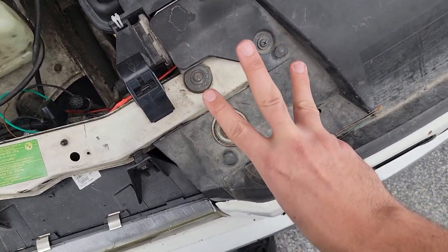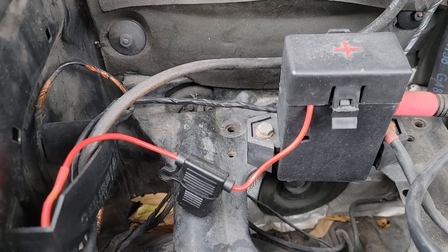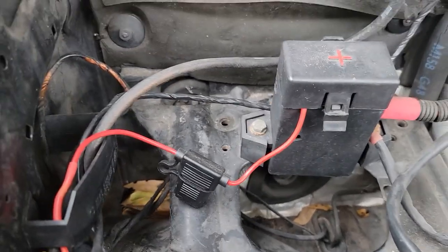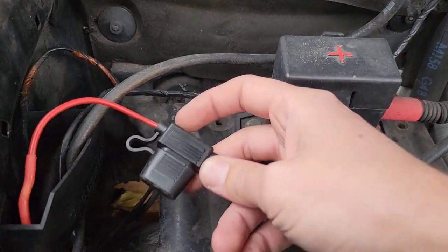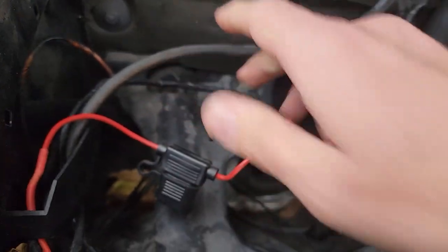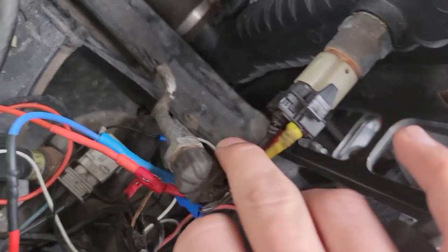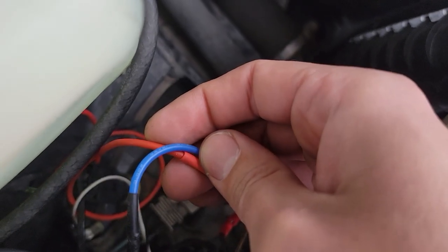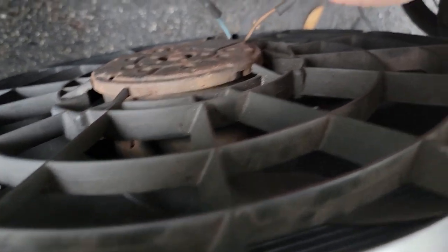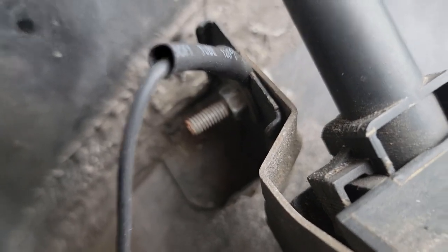What we want to do is bypass the medium speed. With the three wires, you combine medium and high speed together with ground. You get power from the positive, add a fuse so you don't fry anything — this is especially important on cooling systems in hot temperatures. You modify the sensor as mentioned, and you'll be left with two wires which you connect to the fan and the ground, the brown one, and route that in the car.